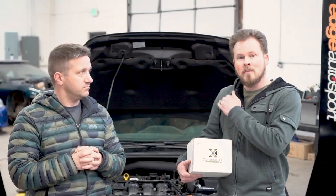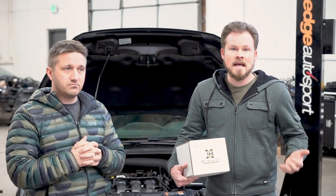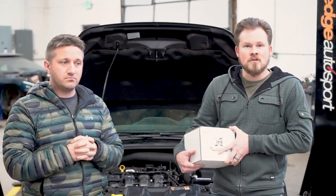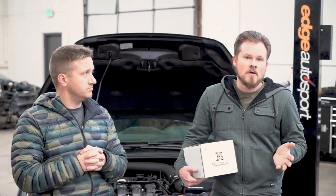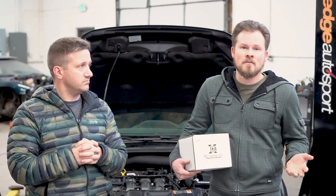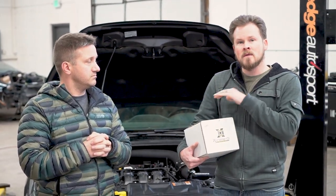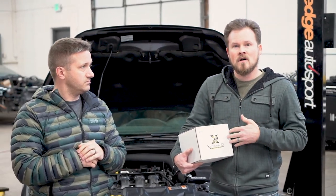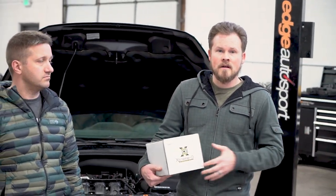We're going to be installing this with the PowerMax turbo still in the car and then upping the ethanol content, because that is a question I get asked all the time — can I run full E85 on my stock turbo? The answer is no. Without upgraded fueling, you shouldn't run E85. You can, but you've got to bring boost so far down that it negates any gains you have from ethanol. So to actually see what is left on the table by running higher concentrations of ethanol, we put this on the car. Right now at our altitude the turbo's maxed out, so any power we get is going to come from the ethanol content and maybe a little bit more spark advance, which we'll be able to run on higher ethanol contents.